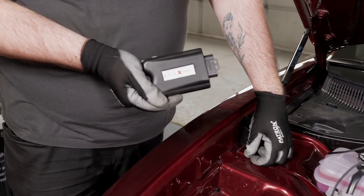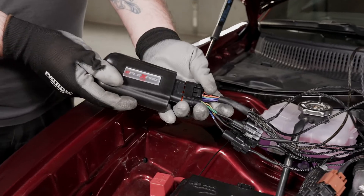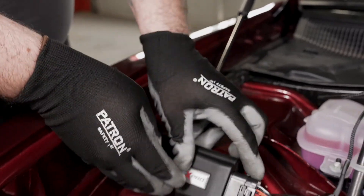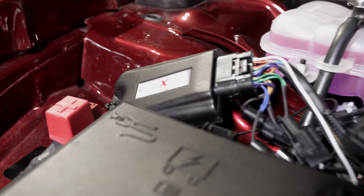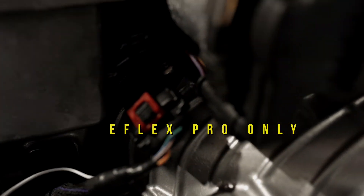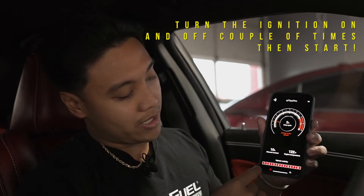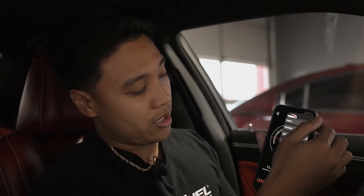This is the control unit — it has Bluetooth connectivity. We'll now connect it to our wiring harness and start the car to test if everything is operating correctly before we finalize the installation. The Pro Kit is supplied with two analog wires that can be connected to the vehicle's own or external sensors. The gray wire is not necessary on this Hellcat. We use a soldering iron to solder in the white wire to the MAP sensor. Now that the installation is complete, start the car and connect to the app. As you can see from the app, everything has been connected properly — all injector activity is on, the ethanol percentage is reading, and the duty cycle reads in real time. Since we soldered in the white wire, you can also check the Pro View.